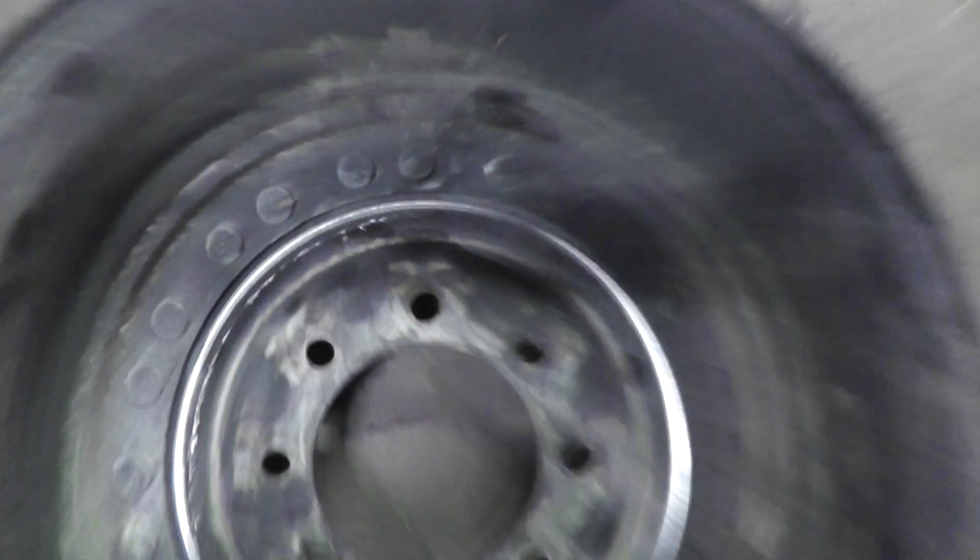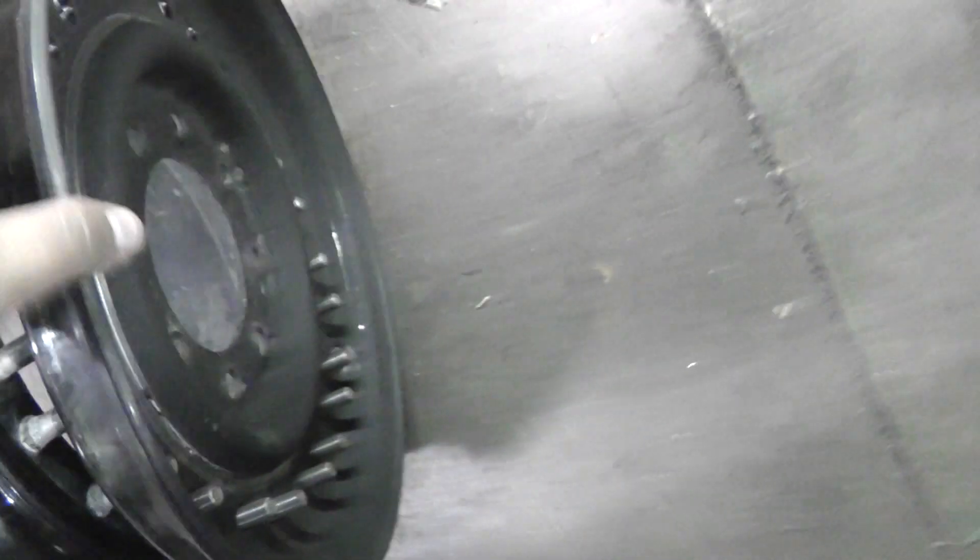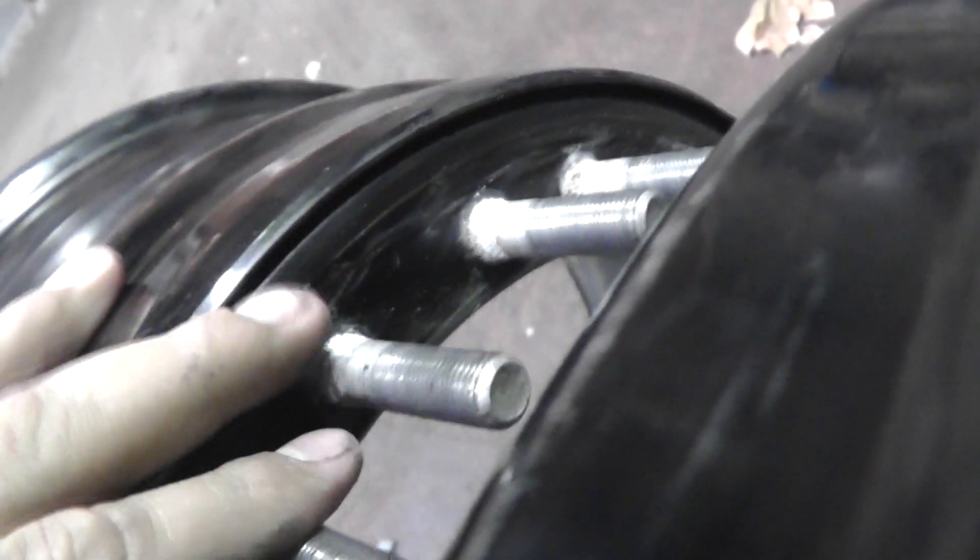You can see right here the back side of the studs. It's two pieces bolted together. And if you look right in here, there's a groove right there where a seal goes inside. You'll have the rubber seal — you put it in there — and essentially you just bolt all those bolts together, it smashes that seal, which seals up the wheel and clamps the two halves.